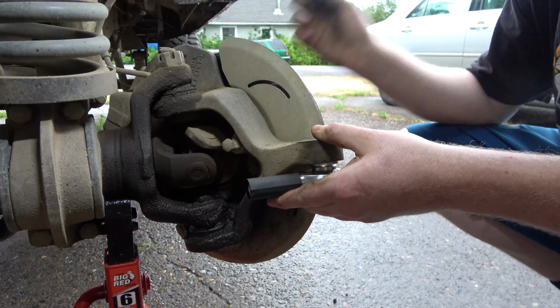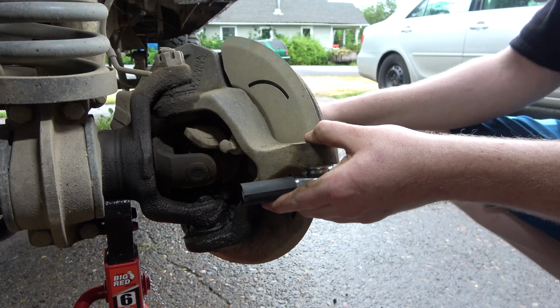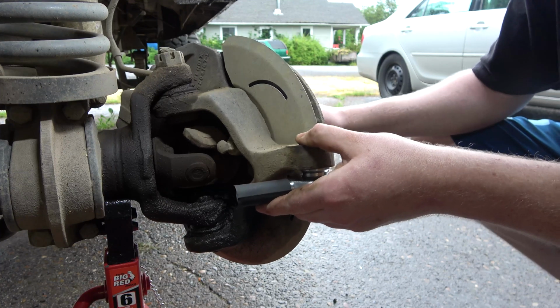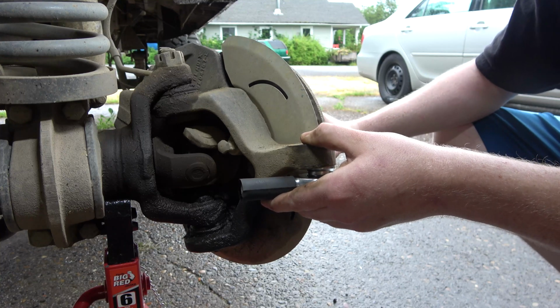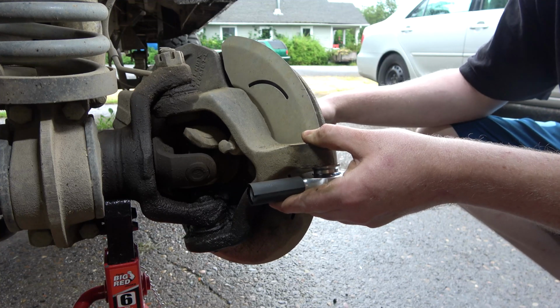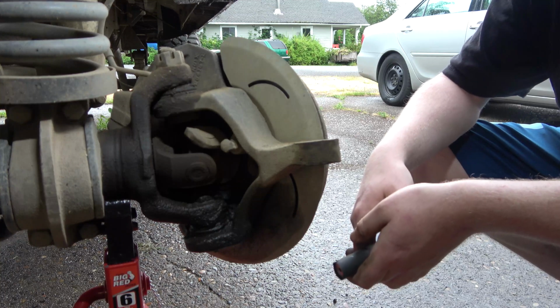We got some thick tubing, so I hope we don't hit the axle housing. If we do run into a problem where we're going to hit the axle housing, we can adjust the stop on this to where it only comes so far. Honestly, what we'll do is have this stop just before that U-joint starts to bind up, and then I think that'll put us in a good position. Drilling that pitman arm is going to be fun.